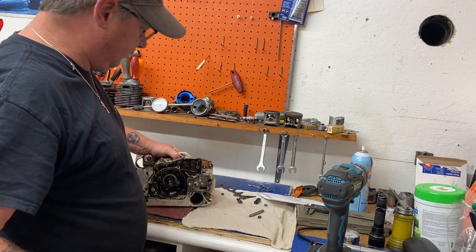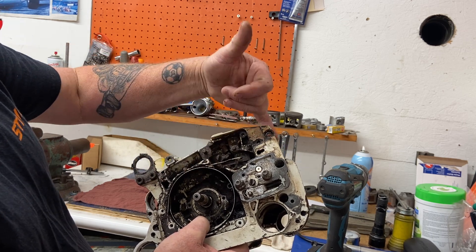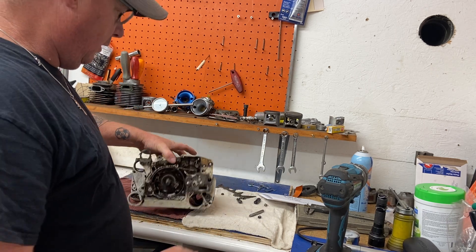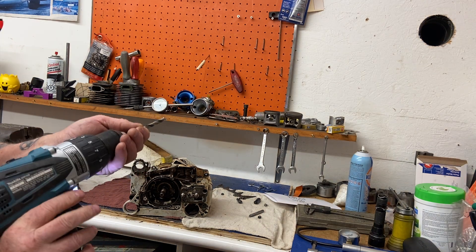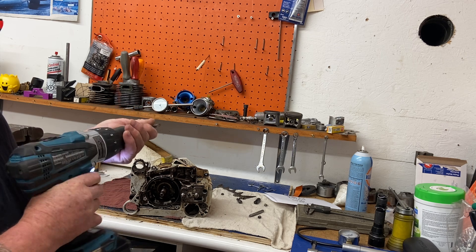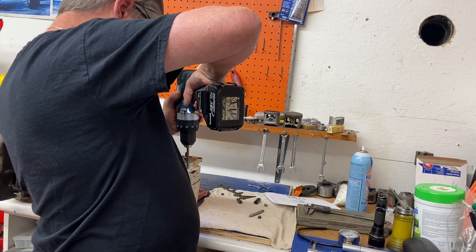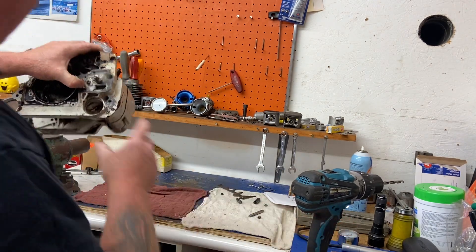Now there's another thing on 066s, 461s, 460s, 046s — this top dog bolt sometimes breaks off. I have a friend that can weld magnesium really well; I get them to weld it, countersink the screw again, and put a screw in it. Might have to start doing that on some Huskies that are breaking too. Okay, so let's get into drilling this. I've got the 17/64 drill bit. Drilling the hole — try to keep it pretty straight. Drill right through; you're not going to wreck anything. You don't go into the crankcase — it's kind of a hollow hole in there.